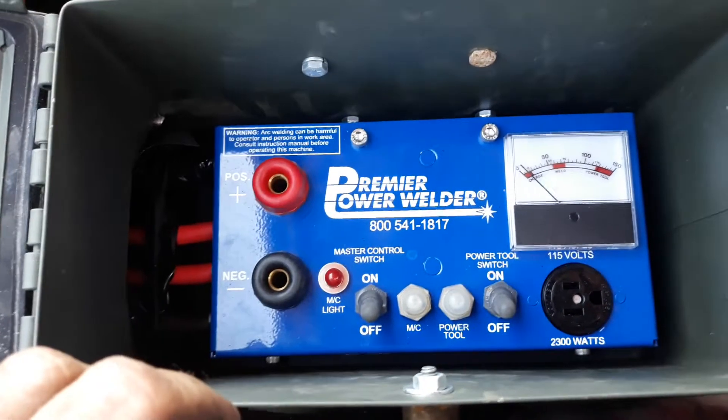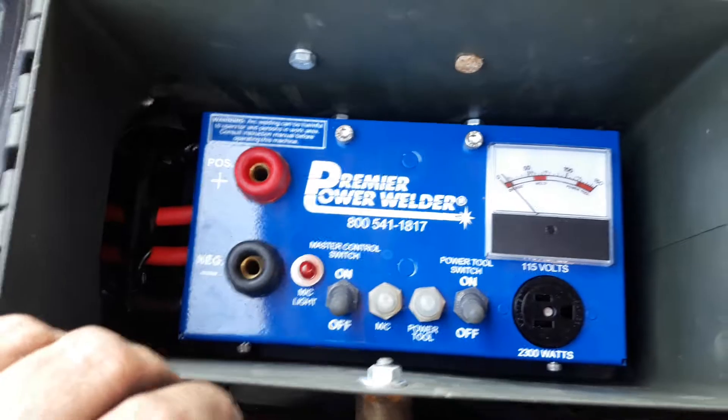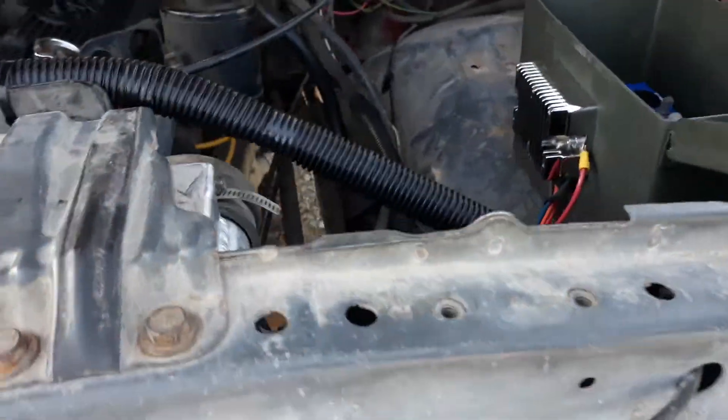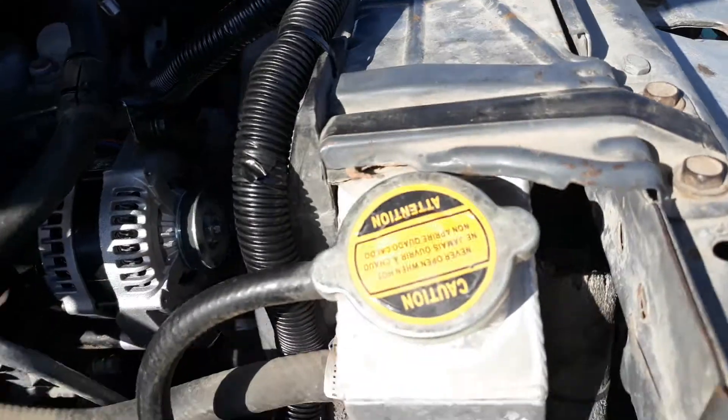It's got one wire — it's probably like a trigger wire — that has to go to the ignition switch, so that probably activates the charge. You want it to be switched. It's a brown wire. Just ran her in through the fender well there and got her tied into the fuse box. Got the other lead run across the top, got them all nice, pretty, and loomed up.